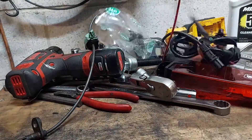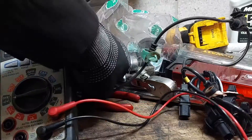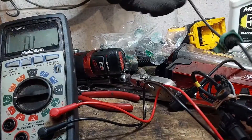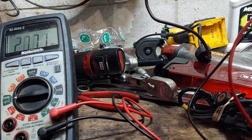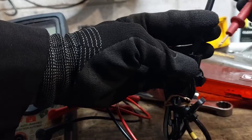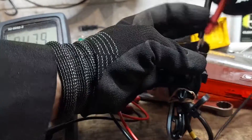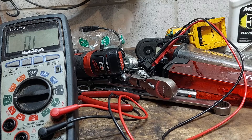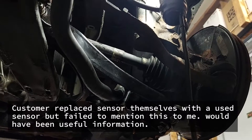I know this isn't even a proper test, to be honest with you. But for the sake of testing — here's the old one. Let's see what the resistance measurement is. Because someone was in here. 25 megaohms. Let's check the new one. 0.479 megaohms. So there's definitely something wrong with that other sensor. The question is, why was it removed? Someone removed that sensor — 1,000%. Who removed the sensor? Was it the donor?